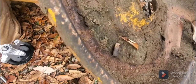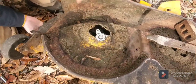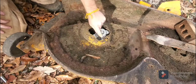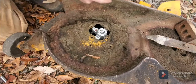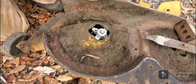So I'm going to go back to the other side and go ahead and put this belt on the pulley. And then have this going on like this. Actually, I think it's like this. Okay, we'll get that. Also want to keep in mind that I want to make sure that the nipple here, the grease fitting, as some people call it, is in a direction where I can best get to it. And for me, that's going to be closer to the entrance here, where I can just pull up the flap, put my gun in. I don't know if I'm too close here. Okay, all right, good. So I want it probably pointing here instead. So that's what I'm going to do.